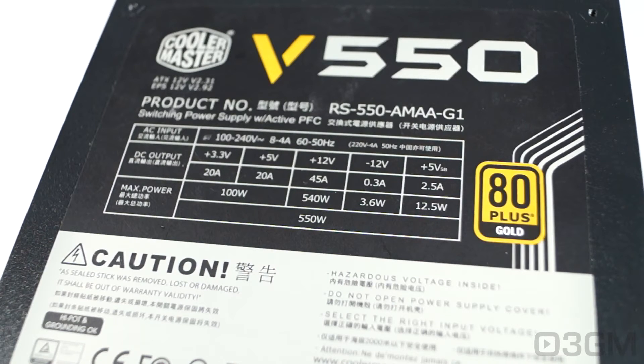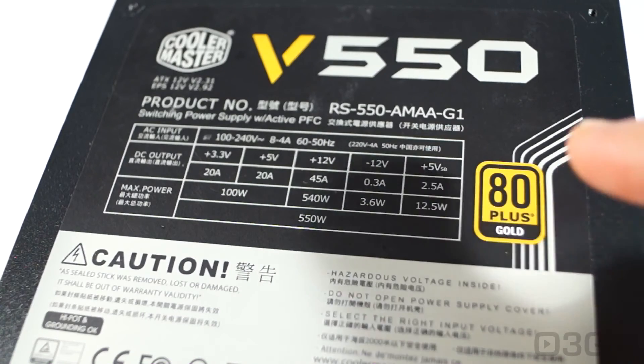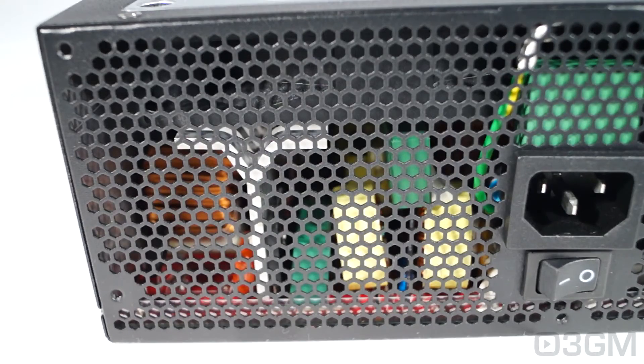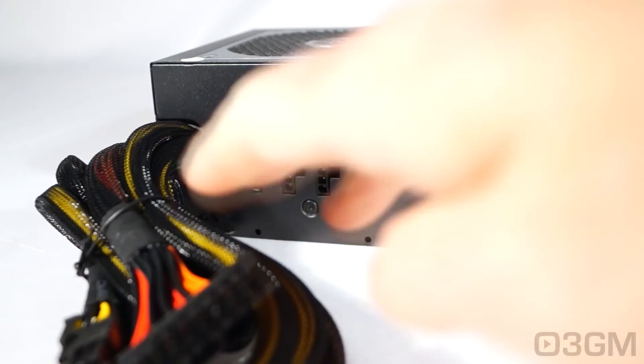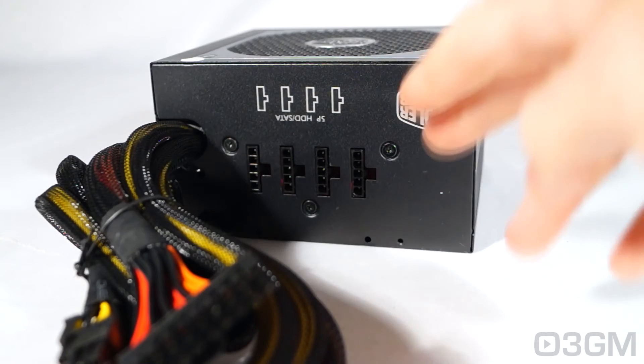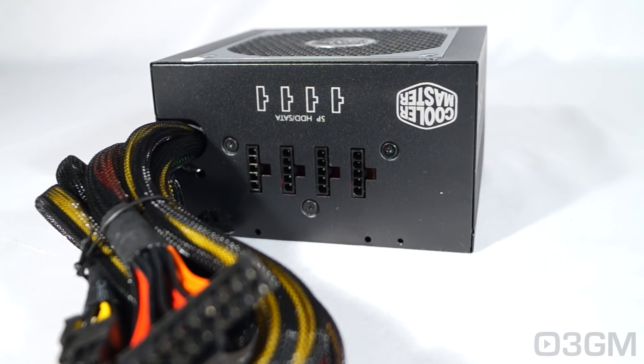Fifth, there are three main certifications: 80+, NVIDIA SLI, and AMD Crossfire. Many of today's high end power supplies meet one or more of these certifications, and this power supply meets the 80 Plus Gold certification. Sixth, and this is very important especially if you're choosing a high wattage power supply, look for one that uses Japanese capacitors, because it ensures a much more reliable product than a power supply with low-grade capacitors — and thankfully this power supply has Japanese capacitors. Finally, get a power supply that has enough leads for your setup. Consider a power supply that has a modular design because it reduces the cable mess inside of the case. It is also very important to get a power supply with a fantastic warranty, and this power supply comes with a five-year warranty.